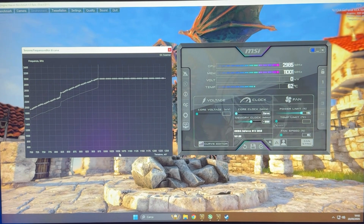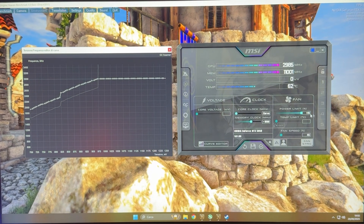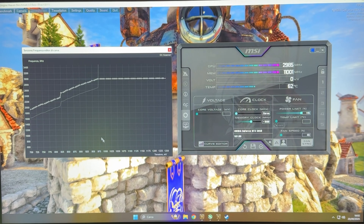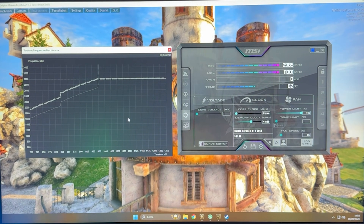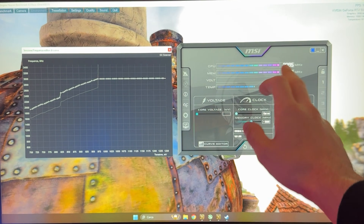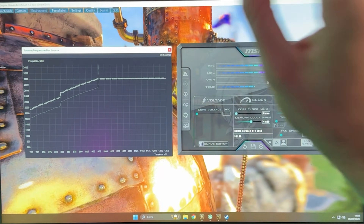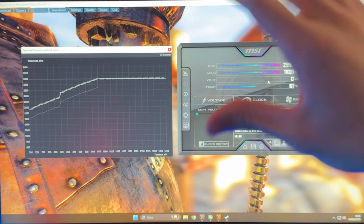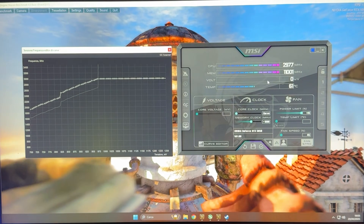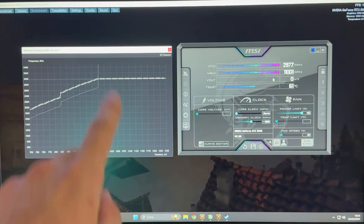As a guideline, you can push all the way to 1 volt (1,000 mV) if you have enough power limit headroom, but 975 is a great spot. On average you can expect to reach around 3.1 GHz if you really push it — higher is very hard below stock voltage. This longer combined overclocking and undervolting video is now finished. If you liked it, check out my other content, leave a like, subscribe, and see you in the next one.